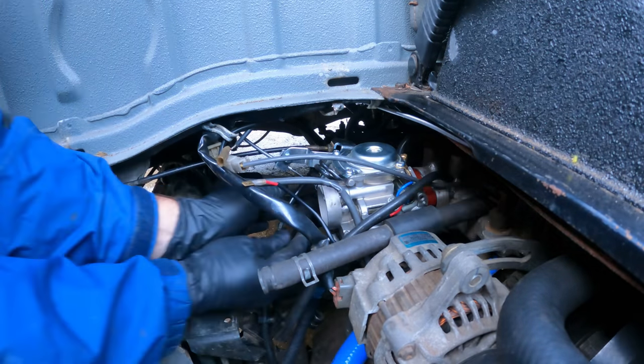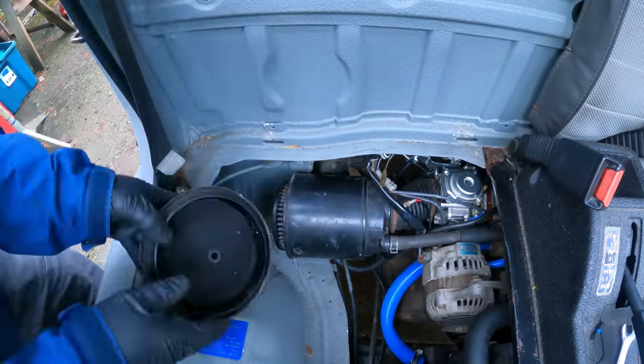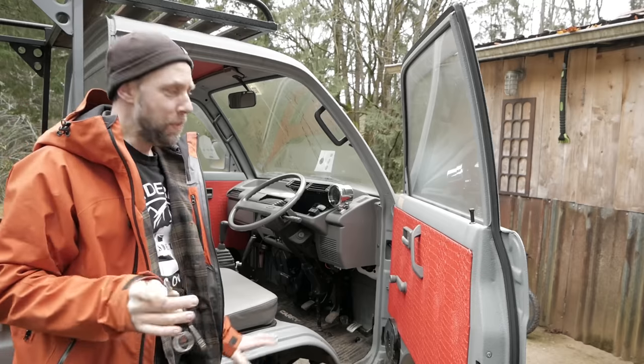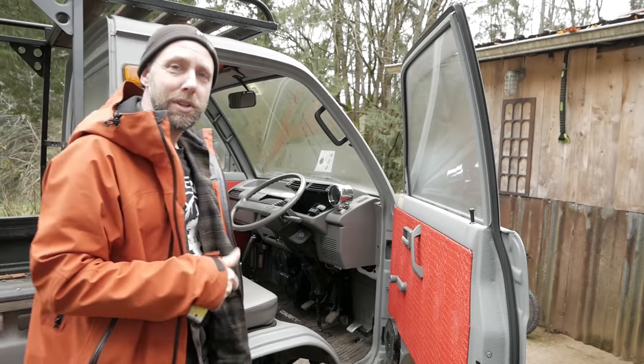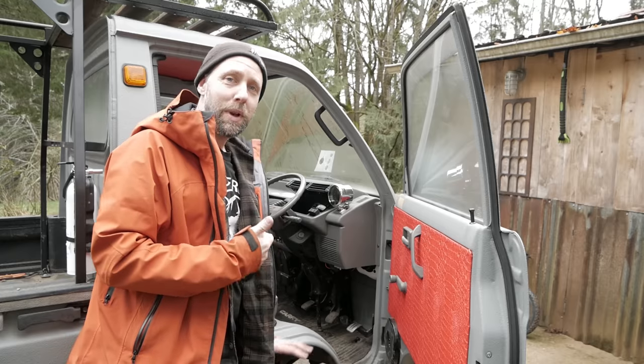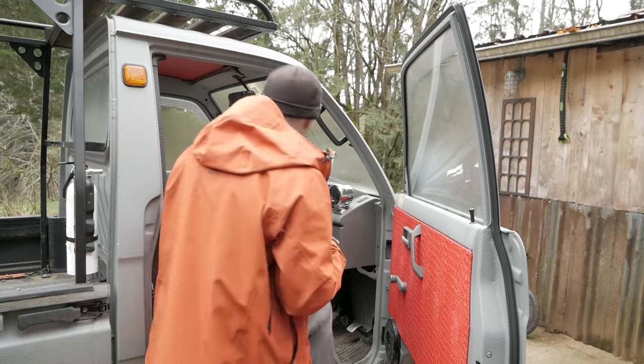And if you ever tune a carburetor, you know you got to take off the float bowl quite a few times to make sure you get the jetting right. All right, so it's about mid-30s out in the morning, and we're going to start this cold start. So we're going to pull on the choke and fire it off. Idle's great. It's never worked this way since I've had the truck, so pretty happy about that.